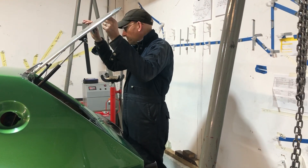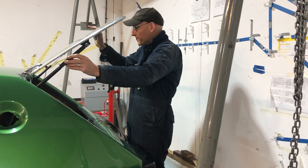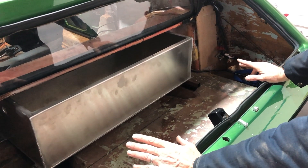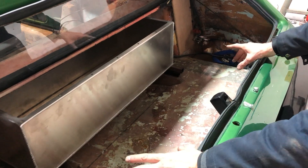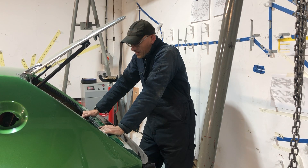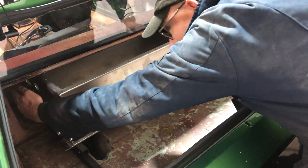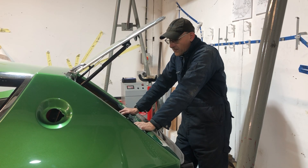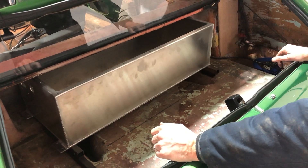So let's have a look in the back. How cool is this for a stay on the rear? Very lovely — that's Lotus for you. So there's the rear battery; that's got six modules in it. Luckily enough, we've got a few holes where fuel pipes came in through the rear of the spare wheel well, so we've got good access to take the high voltage cables out. It's a little bit difficult to actually fix the battery into the fiberglass — I don't really want to drill through it too much. It's double layered and there's a big gap between it. So I'm looking to actually bond a bracket into the fiberglass so that we can attach the battery in there very strongly. It's just trying to make minimum intrusion into the car.